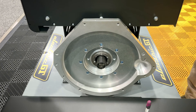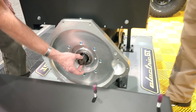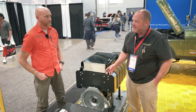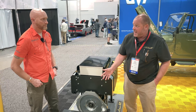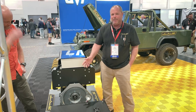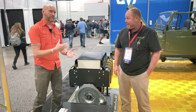Let's talk about the backside — this is equally important. The dimensions fit in a standard engine compartment, especially in old Jeeps. Is this a standard bell housing? Is this a 40-spline assembly? We have a couple of options — spline adapter motor shafts and keyed ones. We make a motor-to-flywheel adapter, put on a very lightweight aluminum flywheel, and use a racing clutch assembly like McLeod makes. We can make any bell housing fit pretty much any transmission because this is all machined billet. You want something rated for over 600 foot-pounds of torque — the motor puts out 410 foot-pounds, which will destroy things if you don't have the proper drivetrain components.